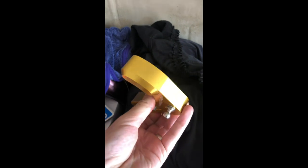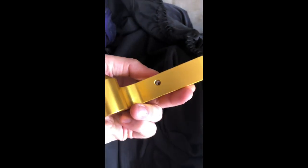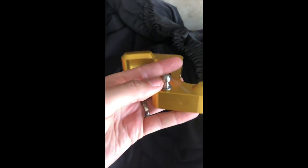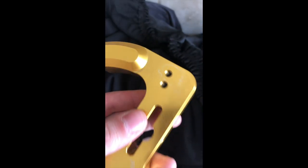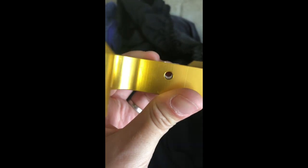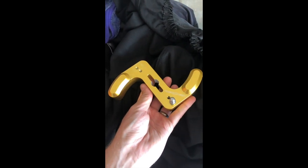Let's take a moment to talk about the quality of this. It's not heavy, but it does feel like a solid unit, as you'd expect from a solid piece of aluminium. The finish is really good. Changing the nipple just requires an 8mm spanner — it's got a little washer underneath it, just unscrews and screws back into wherever you want it. That will go on top of the transmission mount, and there's a split pin that goes through there.